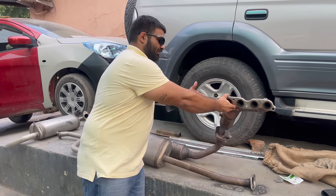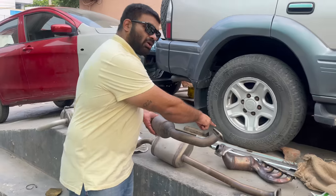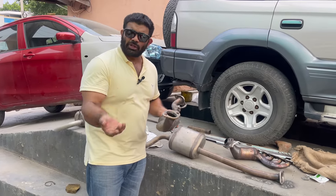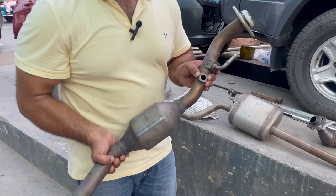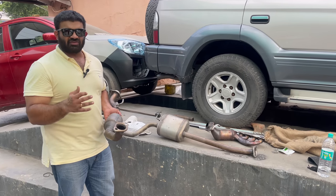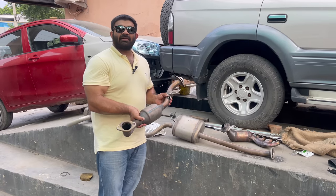This bit joins here — the engine is in this orientation — so it gets bolted in. Once bolted, this is our secondary catcon. That is catcon number one; this is catcon number two. There's about a foot and a half of distance, and the gas goes through catcon number two. This is just a connecting pipe, also called the down tube. If you look closely, you'll notice a similar bung here as well — this is for the secondary lambda, or lambda number two. You get two types of readings: one is the amount of oxygen at the exit of the exhaust entering the system, and after going through catcon one and catcon two, we get another oxygen reading.